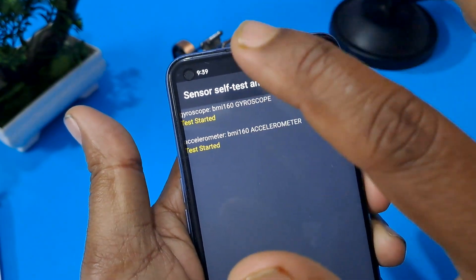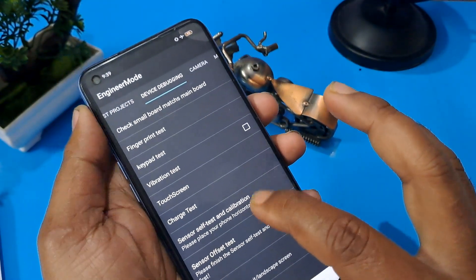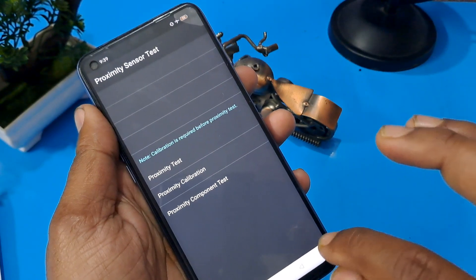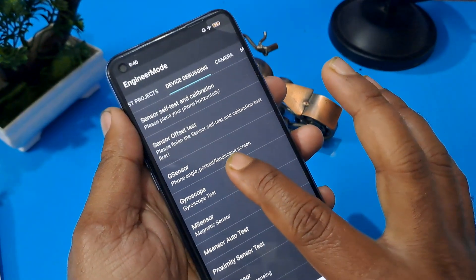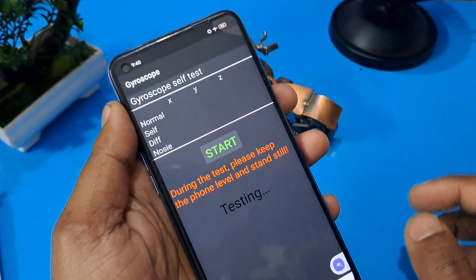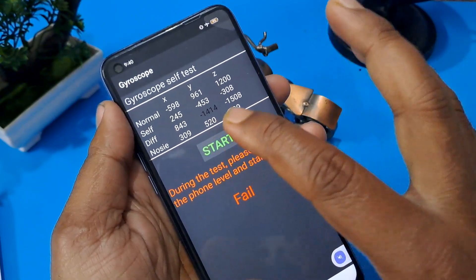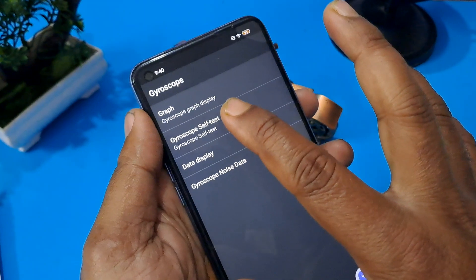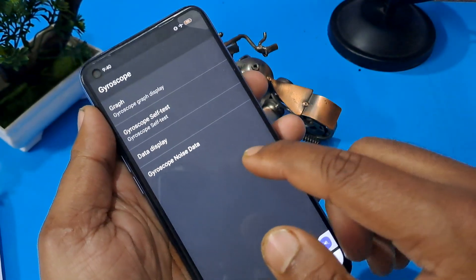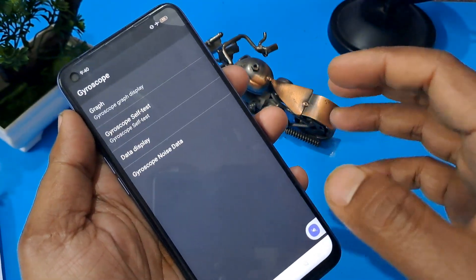Both options may not operate, but now you can see the 'pass' option is coming. Come back from this option and check the proximity sensor test, then the second row proximity calibration — confirm that option and come back. Then check the gyroscope test and see gyroscope self-test. Start the process — wait for X, Y, Z synchronizing — then start again. Come back and check if the graph is working. The graph is working.